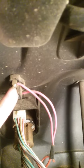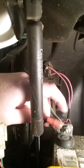Right up there are two red wires that ran to the lights. There's the switch — you can see it. If you want to modify yours, you can do that. Works pretty simple — there's your contact point, put your wire in, run it back down there, and your little pigtail goes to your headlights out front. Here's what I was talking about — this terminal being red. Don't make the mistake and hook this up wrong.